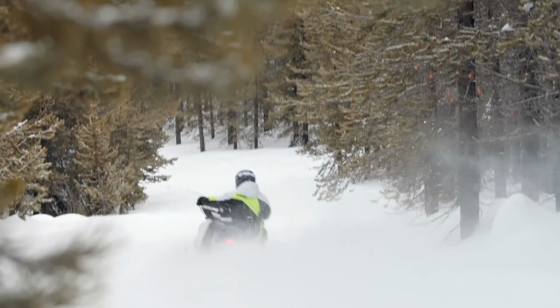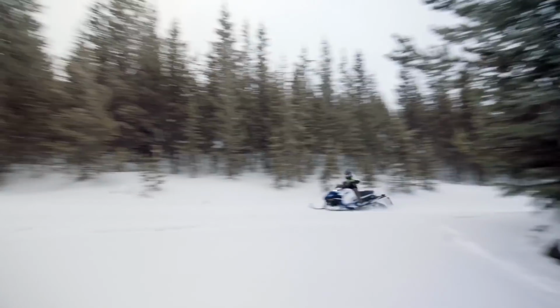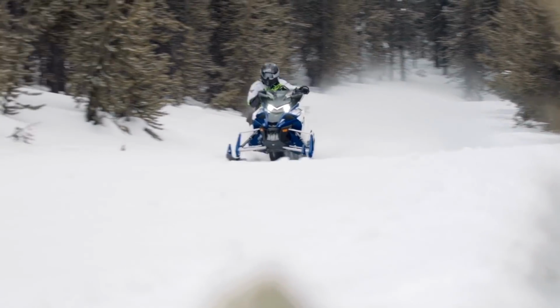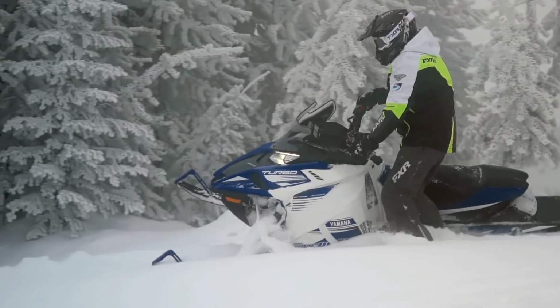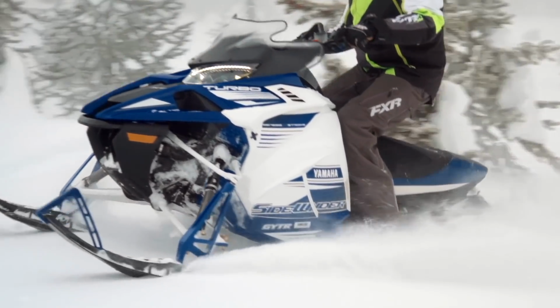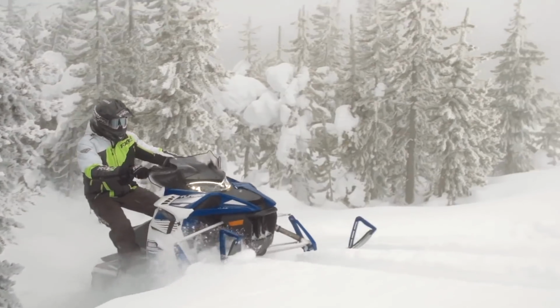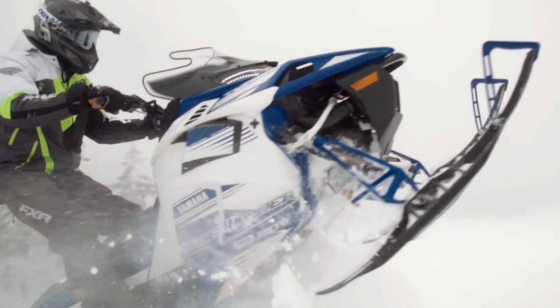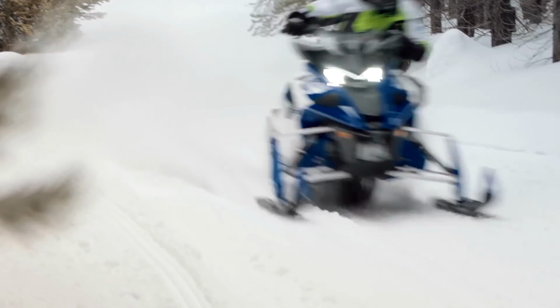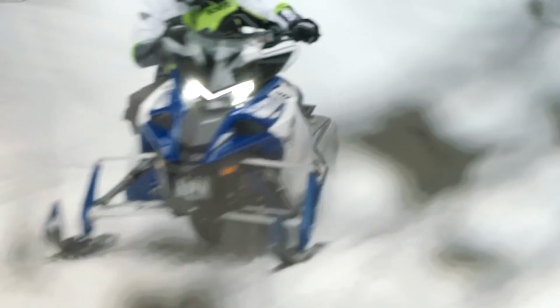Here's where you want to be paying attention to your tach and seeing where your operating RPM is. It also helps to get the sled out into the environment that you typically ride in: trails, hill climbing, deep powder snow, whatever. This is where Quick Adjust is so great. If you think you've added too much weight and operating RPM is too low, or the engine bogs down or is over revving, you can either add or take away weight with the extra adjusters that Dalton has included in the package without taking your clutch apart.